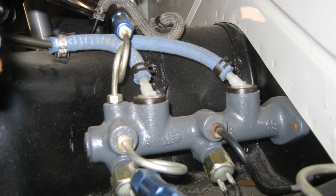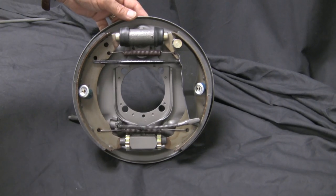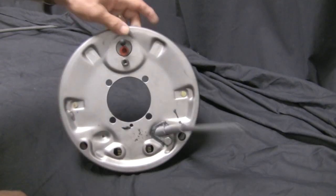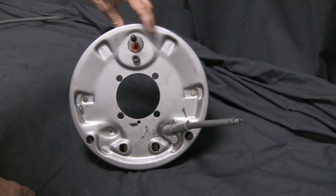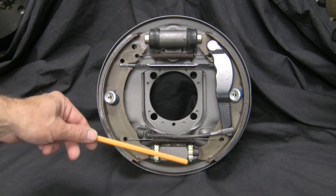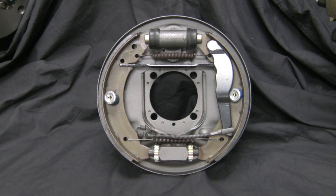With the wheel, tire, and brakes removed, take the time to clean everything in the wheelhouse. Check your pan, steering box and coupler, tie rods, fuel line fitting and line. Take a good look around and check, clean, and lubricate components while they are within easy reach. Save yourself the frustration of not being able to get a pedal once your kit is installed because your rear brakes are out of adjustment — this is one of the two biggest reasons for difficulty in getting a high, firm brake pedal at the completion of the installation. Read your service manual and adjust them, then check and adjust them again. Don't forget to back off your e-brake cables before you adjust, then readjust them to spec.